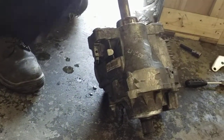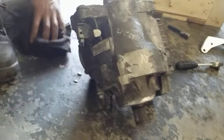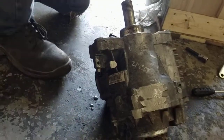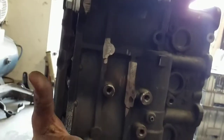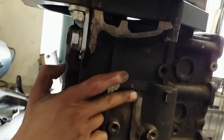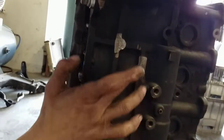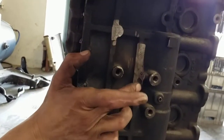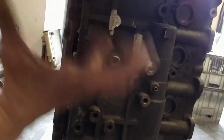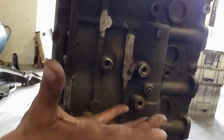So that little area there, this little area here, and then there was just one small blob over here as well — that's all you need to do on the transfer case. That will actually help you get this thing in there more easily and let you not take too much off the block. Before we go to put the transfer case back, just to show you what it looks like now — just remember, I actually went overboard here; you're not going to end up taking off so much. I didn't have a transfer bracket at the time when I did the prep work.